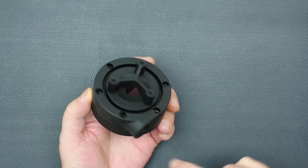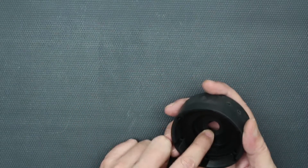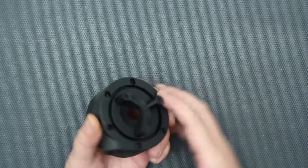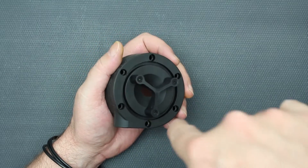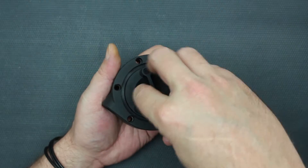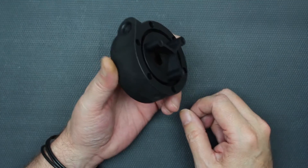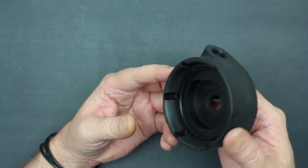What they actually do is, as water is spiraling down in the pump, this lets you mount a D5 directly to a tube reservoir in the modular reservoir system. What this does is keep a vortex from forming inside — like that little spinning water tornado that can draw air into the pump. This is the bolt-on variety and it already comes pre-mounted to the TRP.